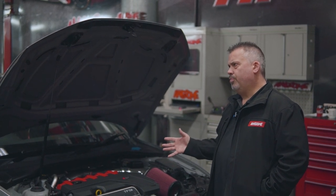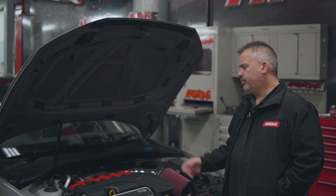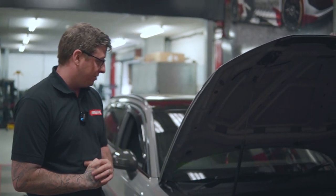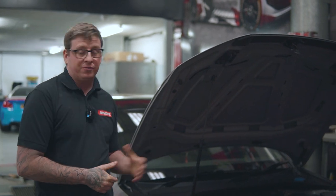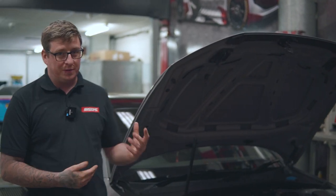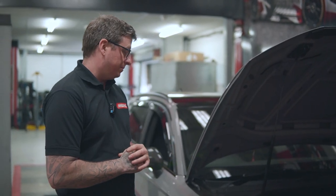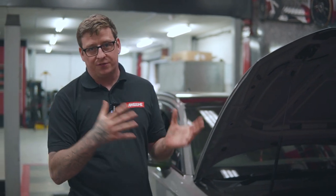The biggest issue with tuning these engines is limiting the torque — keeping the torque down helps with longevity. One of the things we like to drum home is servicing and maintaining the vehicles: regular spark plug changes, regular oil changes. Your DSG — Audi says 40,000 miles, but if you drive hard, do at least half that. For oil, at Stage 3 we'd do it every 3,000 miles or after events. Our advice to customers is every 3,000 to 6,000 miles. You want to run the best fuel you can, in most cases 99 octane.